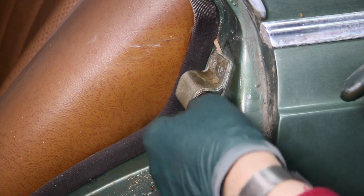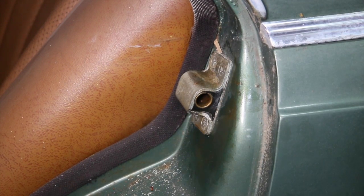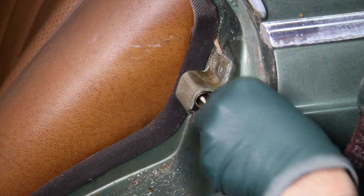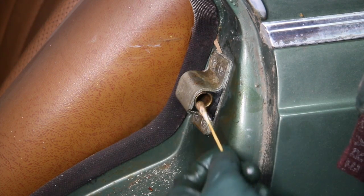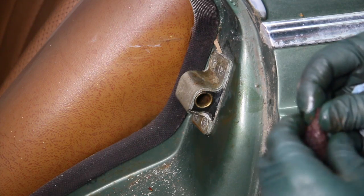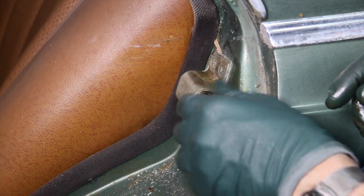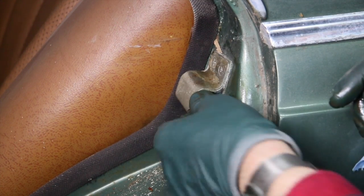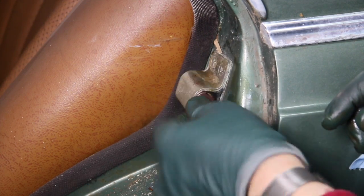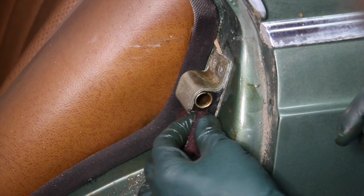And we're going to go after this. Now this is brass, so this shouldn't be severely corroded in here. It's going to be junked up with the rust from the cone, but if I go in here and use one of these swabs, you can see I'm already starting to get that cleaned out. Try to get this to as small a point as I can. Shove it in there. And having the Scotch-Brite pad soaked up with penetrant helps to cut through that rust and crud inside there. So just roll that back and forth like that. Okay, now I'm starting to see brass instead of rust.